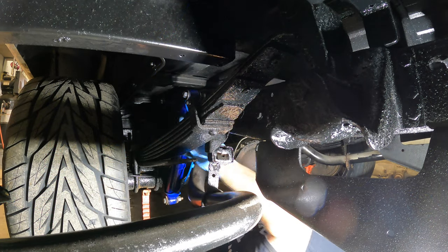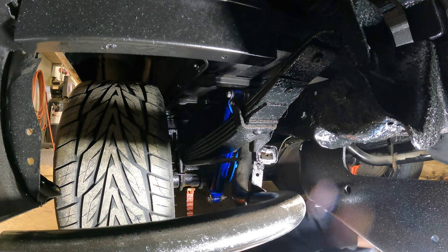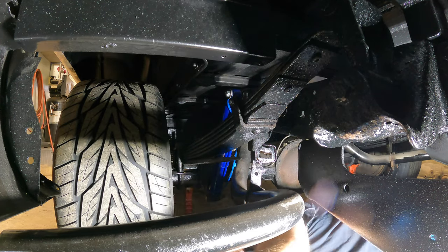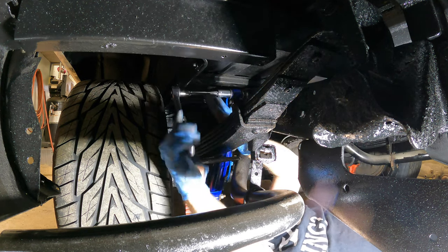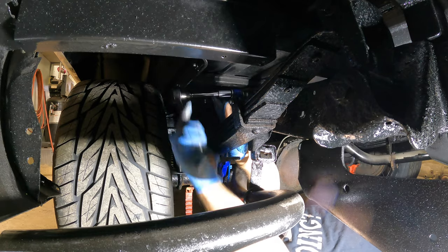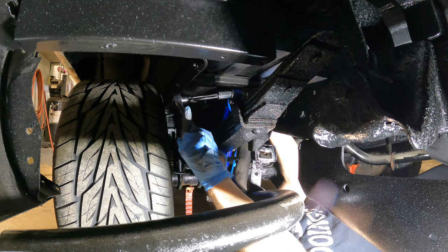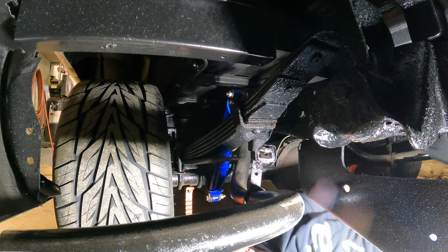Let me get the camera back up there. What we're gonna do is get this up in here and tighten it using a ratchet because I haven't got enough room between here and the tire well. Extension, socket, ratchet in the hole - tighten. Oh that ratchet's working good. Careful - the shock will come off easy. Put never-seize on them. That's tight enough. So the shocks are on!